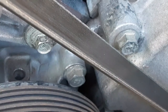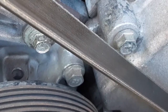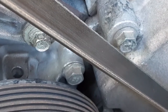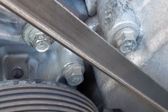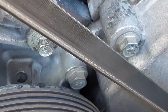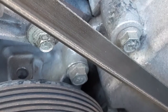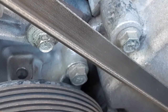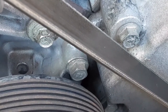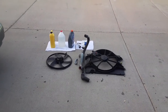Plausible causes of a major overheating issue — very embarrassing, very frustrating — starting with the weep hole on the water pump. If it starts to leak, even if you don't see the drips, it's time to replace it. But that may not be it, stay tuned. Could it be the coolant or the coolant mixture?